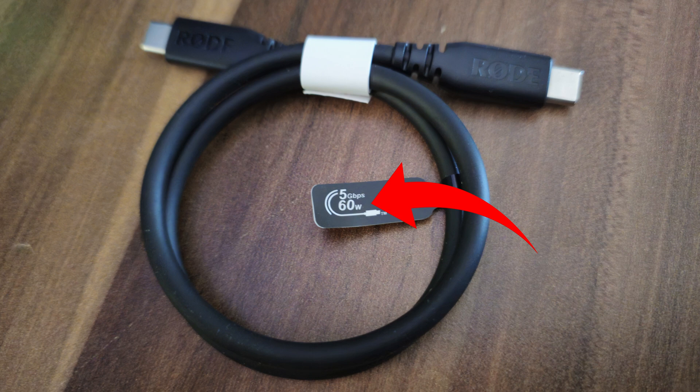However, it's not just about the charger itself — the thing you plug into the wall. It's also about the cable. Make sure that it is a pure Type-C to C cable on both ends, and that it's actually rated to support these higher wattages. Usually there's a sticker on them telling you exactly what wattage it supports, or if you're buying one online, it will say so on the web page itself.